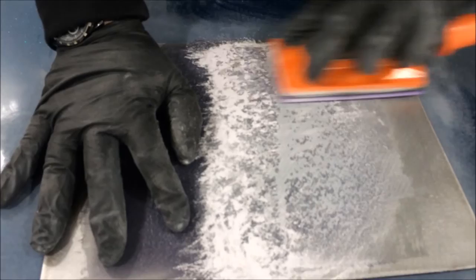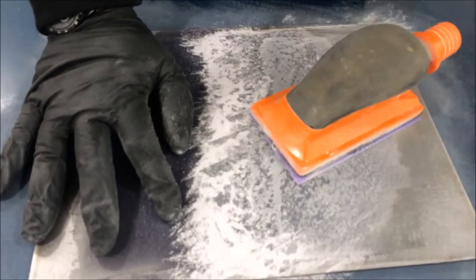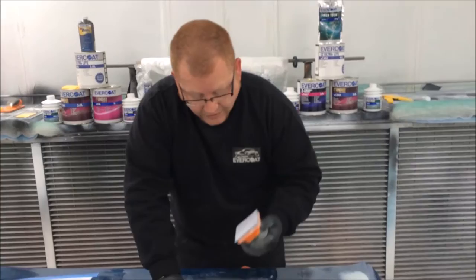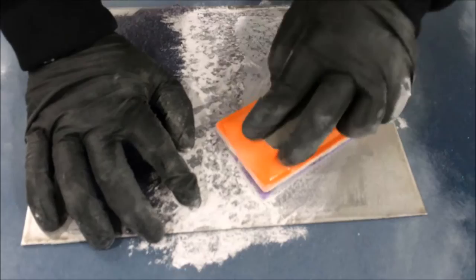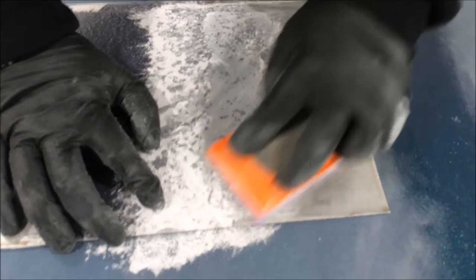And this stuff would be ideal over welded areas and whatnot? Yep, like we talked about earlier, about wanting to cap your welds off with a fibre-reinforced paste, this would be the ideal one. The main reason, once again, is you're going to make such a good job of applying it that you're going to minimise the amount of sanding you need to do afterwards. Your method of application will reduce the amount of labour, the amount of product, and the amount of abrasives you're going to need to use to sand it.